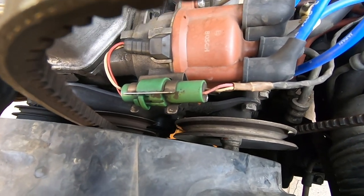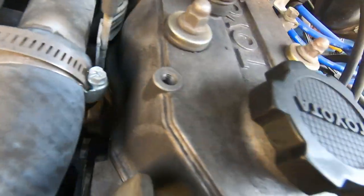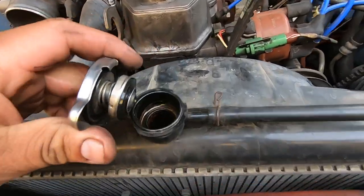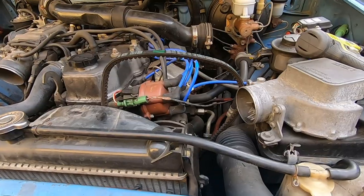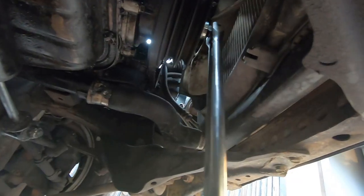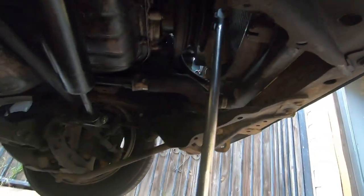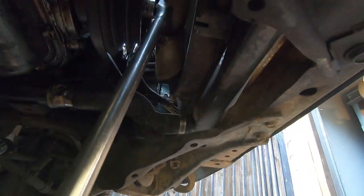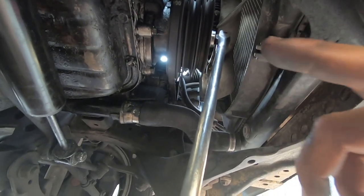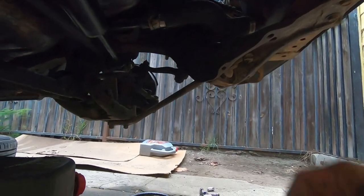We're gonna try to pull off the oil pump without removing the radiator — I don't know if it's possible but we're gonna give it a try. I think it's leaking coolant up here somewhere because there's a little drop of coolant right there and this goes low every so often, so we'll have to figure that out as well. We're gonna see if we could break the bolt loose on the harmonic balancer. We got the breaker bar on with a 19mm and the truck in fifth gear. We were able to break it loose — all we had to do was lay the breaker bar up next to this bracket right here and bump the starter, and it rotated and broke it loose.